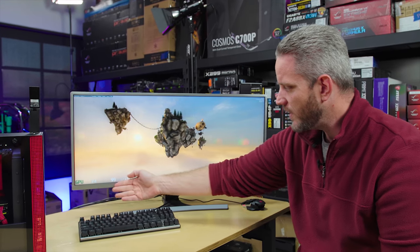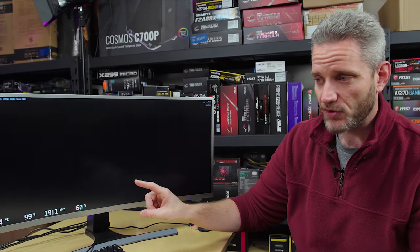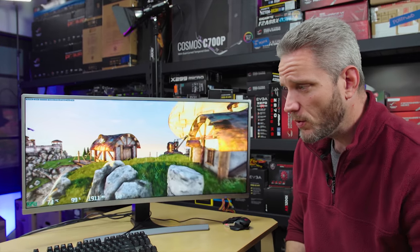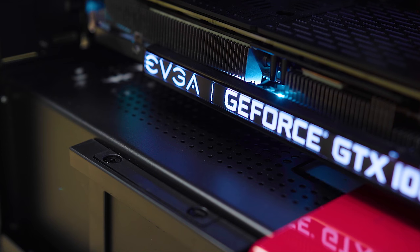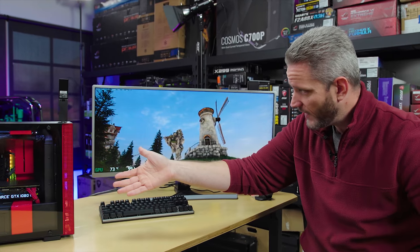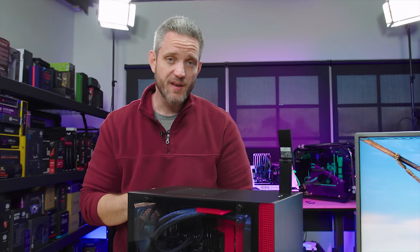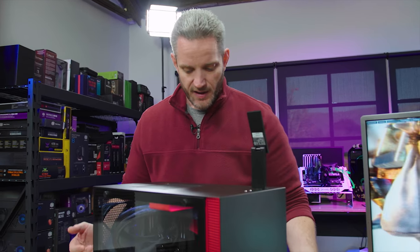We've stabilized, bouncing between 73 and 74C. Fan speed increased slightly from 58 to 60%, which I believe is the max factory fan speed for this EVGA card. We're still locked at 1911 MHz, so we came down one speed step. These temperatures are actually really good — we've got a small form factor case, perforations on the side, a front-mounted radiator, and a non-blower style cooler sandwiched up against a blocked-off mid-plate. Literally everything people say don't do — we're doing it — and temperatures are doing really, really well. As you bring up ambient temperature in the room, your GPU temperatures will rise incrementally with ambient.